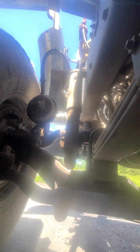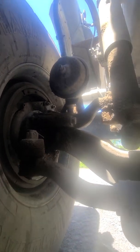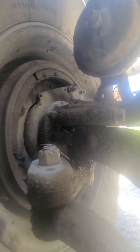The person you're buying the truck from is gonna be tripping like, what is this guy doing? Get under there, look. Make sure all your tie rod ends are good and tight. Make sure that thing's been getting greased, because how they take care of it is how it's gonna be. Check your leaf springs. Look at that, no oil leaks. That's what I like. You got a little right here, but you got no oil leaks. You're looking good. And you just make your way back.